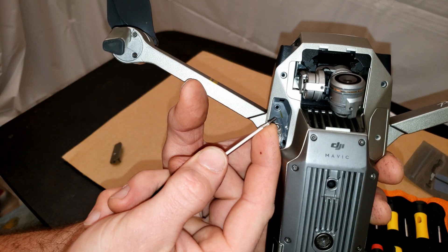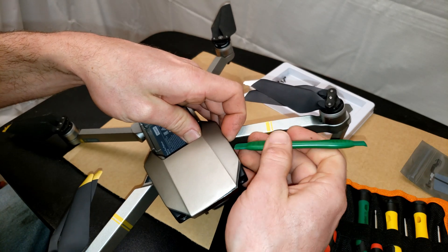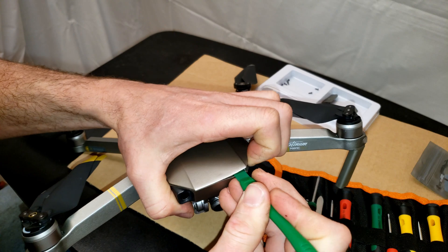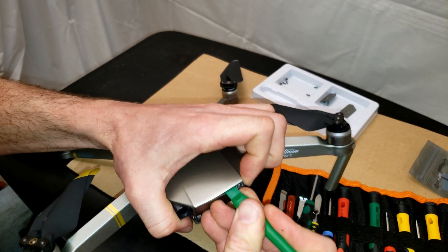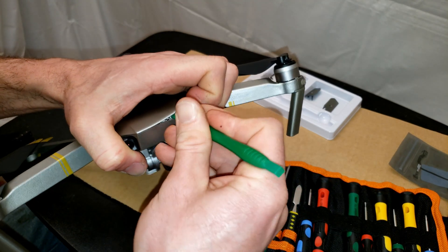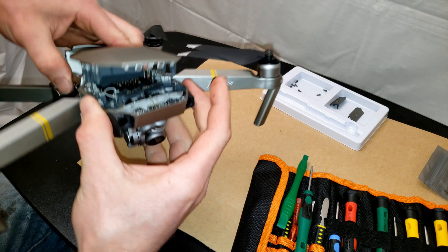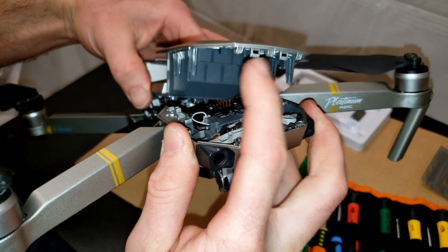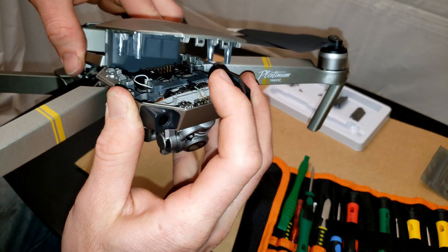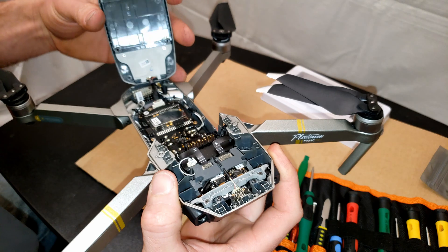These screws are the same size as the rest of them. With those off, you want to get fingernails under here or a small plastic tool like this and start separating this case. It's extremely tight, so I don't know if there's a great technique for this, but let me see if I can pop this off without breaking it. Just a bunch of plastic clips. These two up here are very stubborn but delicate, so if you come in the front and push those with a tiny screwdriver, that'd be great.